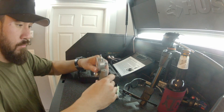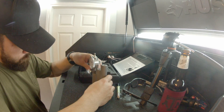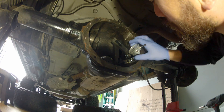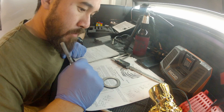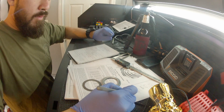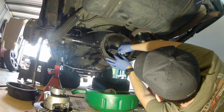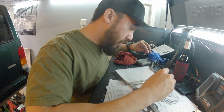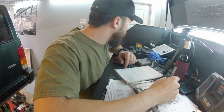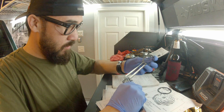The video is going to get a little bit out of order here. This tool is actually what's going to help you figure out the pinion depth and what shim to use on the pinion. It's a pretty confusing tool to use — there's a lot of math involved — and if I sat here and showed you how to figure out the pinion shim, the video would probably be about two hours long, so I'm going to skip through it. There are plenty of YouTube videos on pinion depth. In the end, I find out that the factory shim I have is a couple thousandths too thin, and I need a thicker one.